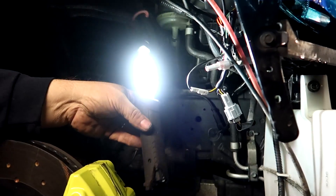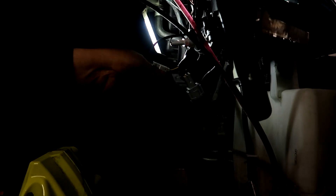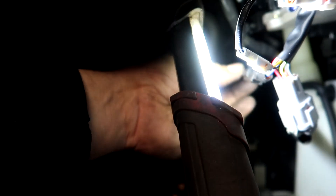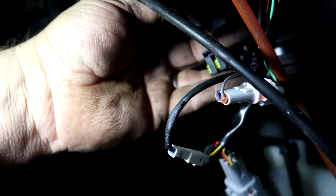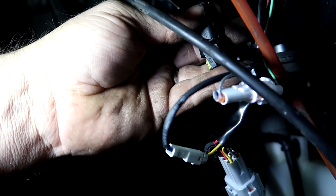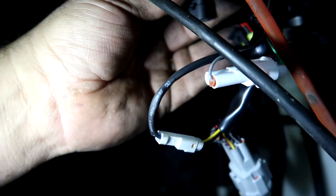Everything goes back in its little home. Basically you're plugging the harness into the car's wiring harness, and the plug goes straight back into the back of the headlight from the main harness. This is where you're connecting the link wire so it runs back across the car. You've also got your sequential lights — we believe unplugged gives you sequential lights, while plugged together gives you ordinary indicator lights, but we'll get into that a bit later.